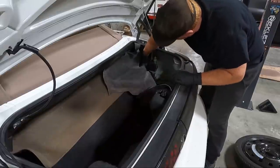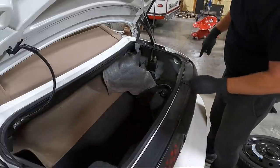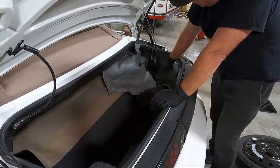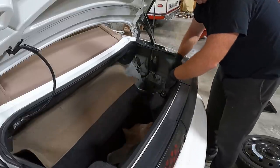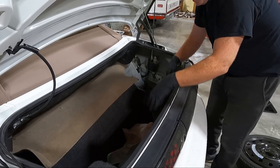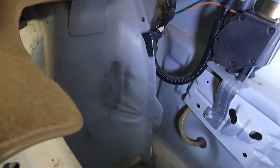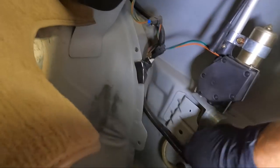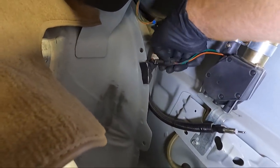Now that we've got the spare out of the way we have access to the antenna. I'm going to take this whole unit out. I'll bring you guys in closer to show you what's going on. We need to unplug a couple things — the Motorola antenna plug and then the power connection. There's also a 10 millimeter bolt at the bottom and a drain — you can see the grommet that goes in the side — so we can pull that out. We'll clean the grommet up; it's there so any water that gets around it drains out and doesn't sit in the side.